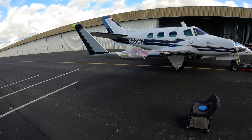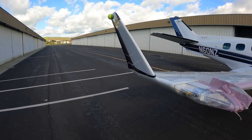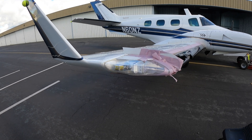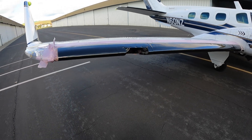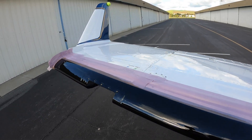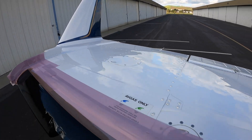While the PBS is drying, maybe I'll give you a tour of the Duke — 60 November Zulu. Here starts the wing tip. I put these winglets on it along with the strakes. It already had the VGs, so it's got the winglets. Also got the LED lighting modification on the end. Boots are brand new with the paint in 2019. This is a 75 B60 model, so it does not have the wing tip tank. It holds 202 usable gallons without the wing tip tank.